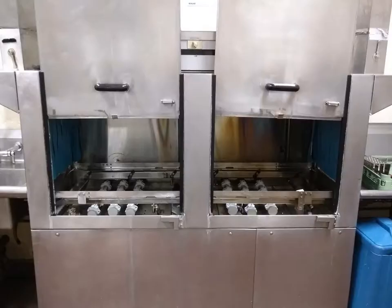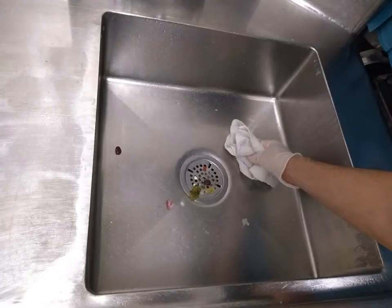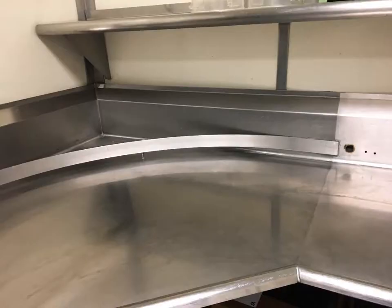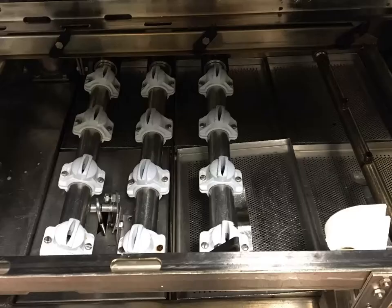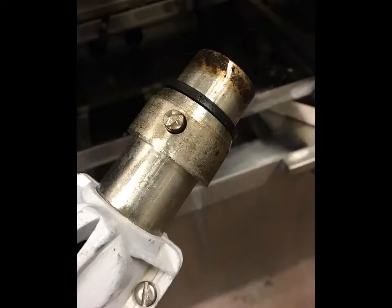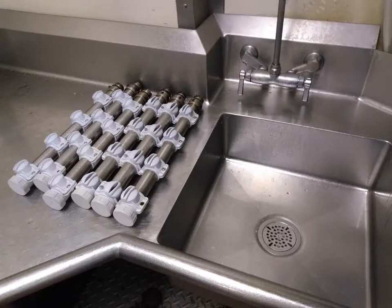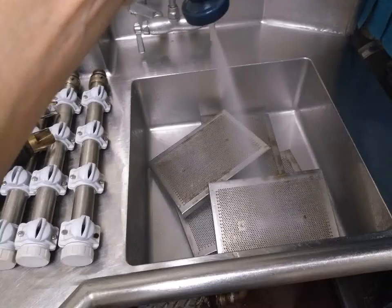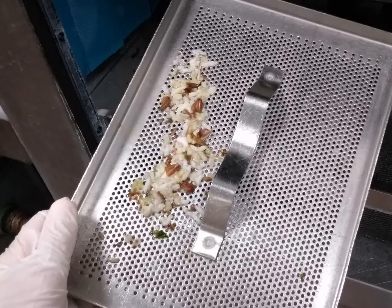Switch off the machine. Wait a few seconds before you open the doors. Lift the drain plugs. Empty and clean the two sinks. Sanitize and clean all stainless steel surfaces and any nearby walls that may have been splashed — leave behind no food particles, they are your enemy. Now disassemble the washer: remove the nozzles, rinse them off in the sink, and set them aside. Remove and clean all the strainers and the drain plugs. If there is a lot of food accumulated on the strainers, then you could have done a better job pre-washing your dishes.